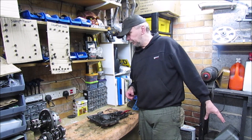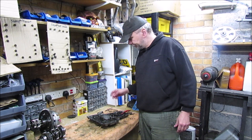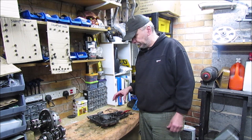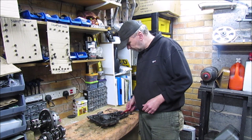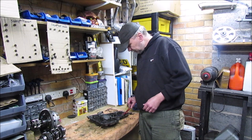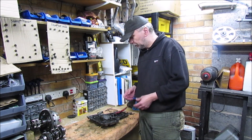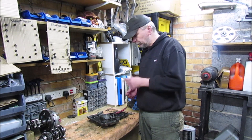I've moved the crank and the cases down to the floor for now, and started working on the sump. All the gaskets have got to be removed. As you remember, it was pretty gunked up and nasty in there. I've put some degreaser in, left it soaking, and I'm going through with an old toothbrush just trying to clear out some of the grit and dirt. It's obviously mixed with the oil so it is moving around a lot more, but clean areas are starting to appear.